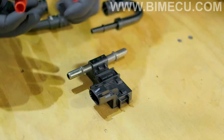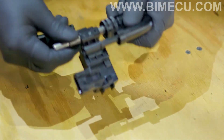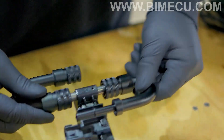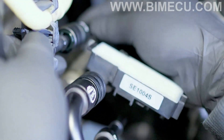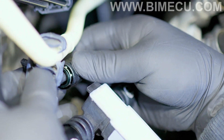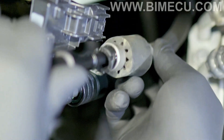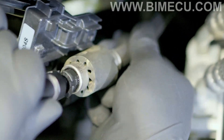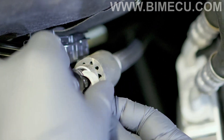Now get your ethanol sensor and install your 360-degree fittings. Pull the quick release back and you'll be able to click it on — initial lock in place. Now install a 360-degree fitting onto the main line: pull the clip back, it should click on — make sure you pull it and it's on. Now click your main fuel line back on; you should hear a click — tug it just to make sure. Don't forget to install the fuel line safety clip; it should click right back into place.